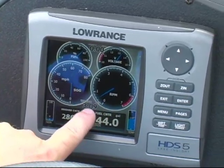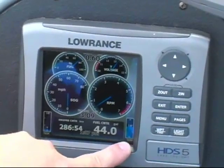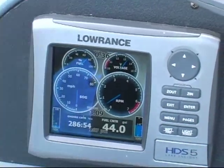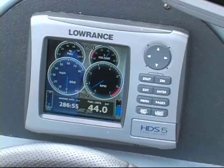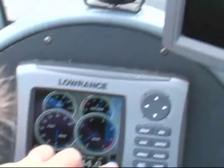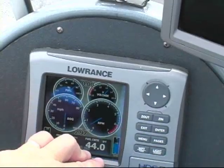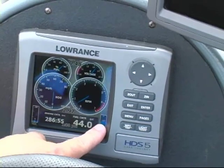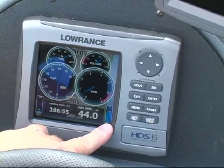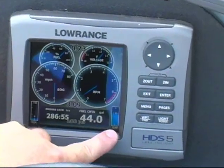I have something important that goes along with my water pressure gauge: engine temperature. You want to look in your owner's manual, find out what your parameters are and make sure it stays in those parameters. The nice thing about this setup is I can set the cold temperature and the hot temperature anywhere I want, so I can know I've got it running inside the range my book suggests. I run my hot a little hotter — I really don't want to run much more than 180–182 on this engine; that's the high end of getting in trouble. So I run my high at 200 on my gauge so I can start to see it get to 182 and know I'm in trouble. At idle or trolling speed it's around 140–150; running wide open it stays around 132 to 140 depending on water temperature. With my water pressure and engine temperature, I can really start to see problems before they become problems.